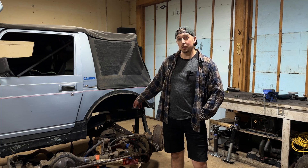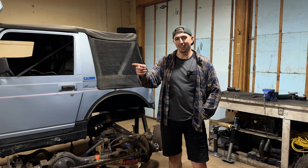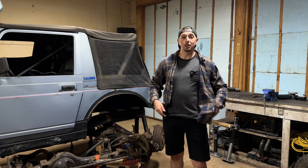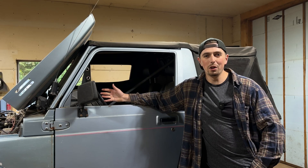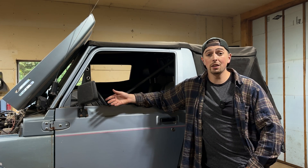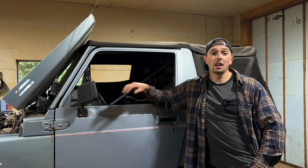We'll start by cleaning that up using the grinder and cutoff wheel. We're then going to take a few different photos of the axle housing, throw those into SolidWorks, get designing on the truss, cut it out on the table — which is the funnest part — and then we'll do some assembling and welding to finalize this video and be ready for our next series where we're going to finally start assembling the rear four-link with the final designs. Thankfully the plasma table reduces a lot of that work and makes it a little bit cleaner.